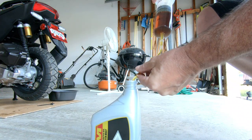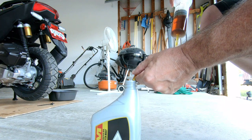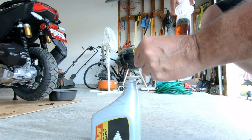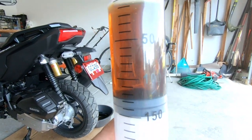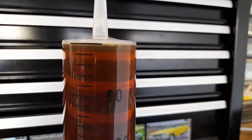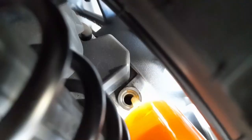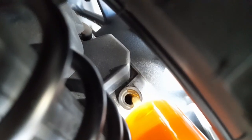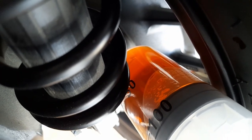I have a link below to pick one of these up if you need one. I mean, there's plenty of other ways to measure 123 milliliters, but this works for me. So each mark on this syringe is 10 milliliters. So this was very close to the target, 123. It looks like it's slightly over, but look, there was some small amount of oil left in the syringe when I was done, so it was nearly perfect.